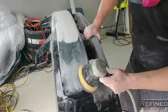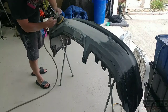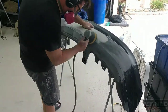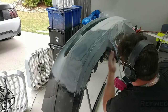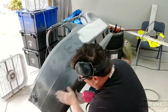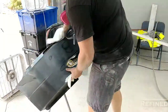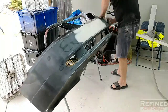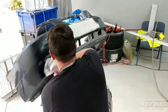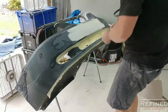The bodywork on the bumper cover is done. Now I'm prepping for primer — stepping out the repair area with 320 to 400 grit scratch, which is where your primer is going to feather edge. You can see I'm hitting all the little nooks and crannies with a red Scotch-Brite pad, which is about equivalent to 400 grit. After a quick blow-off, I gave it a good wipe down with some prep solvent and started taping everything up.